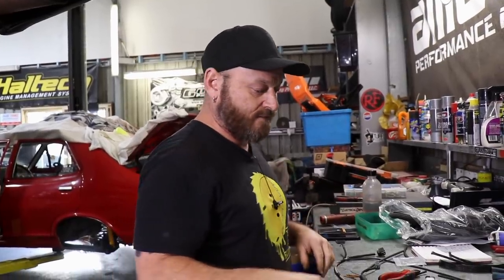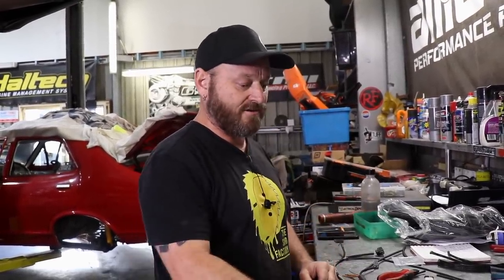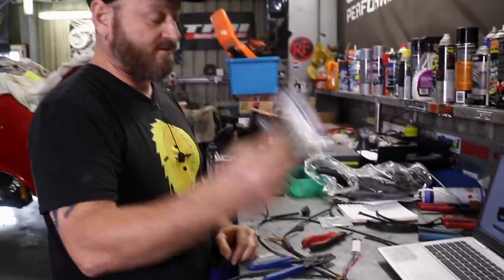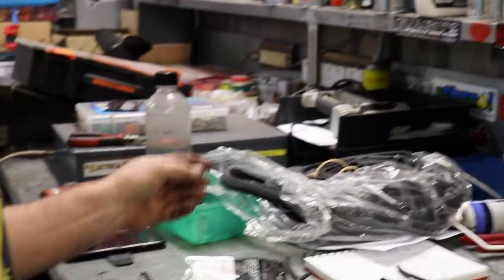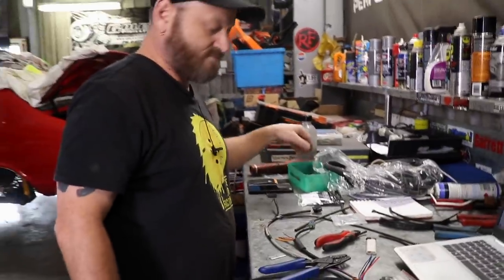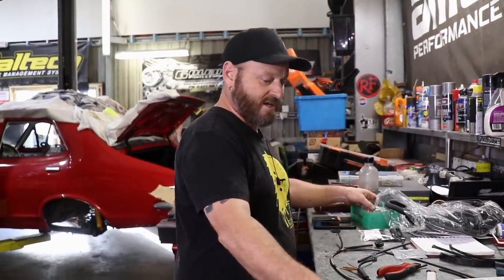I'm using expandable sleeving on it, which is the fashion of the time. You don't have to use that — it is pretty fiddly, you've got to heat shrink the ends and stuff. This is the kind of stuff they use on OE looms — it's just nylon sleeving, it's dirt cheap for like 30 meters of it. It works perfectly fine and it's much less fiddly. It covers the wire up and stops it rubbing. Always use new connectors if you can — you can buy most stuff. Connectors from Golby's — that's just 1JZ crank and cam sensors, these came with the pressure sensors, and there's the throttle body connector. Most of the other stuff you'll get connectors with a sensor. You can buy most stuff, you just got to go looking for it.